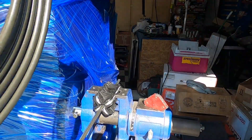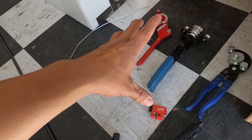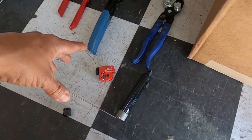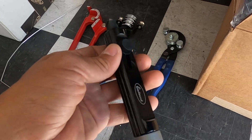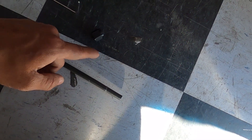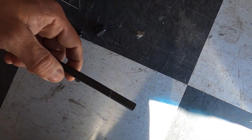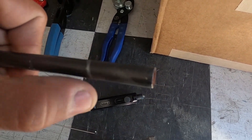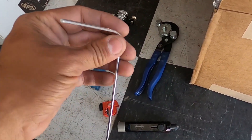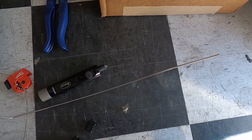We've got the tube pretty much straightened out as much as we need for now. It can get a little pricey if you don't have tube benders, cutters, and a deburring tool to clean up your cut. First things first, we're going to cut the tip off and flare the very first tip before making the bend — you always want to flare it first before you bend it, because sometimes you won't be able to get it inside the flaring tool. Here's our welding wire mock-up; we put it up to the car to see where the line is going to run and get a good idea of where to bend the tube.